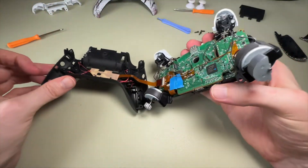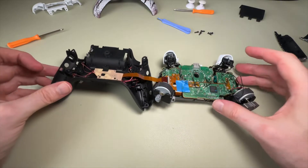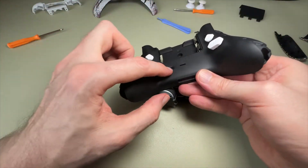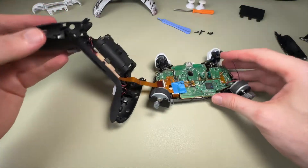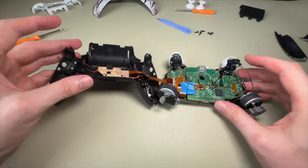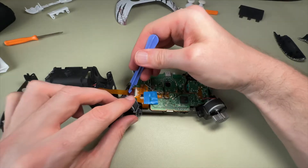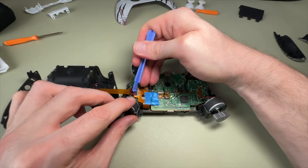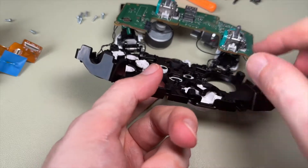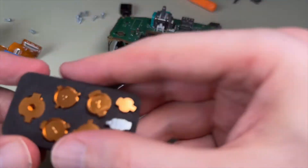As we flip it over, you can see the circuit board and cabling installed for the back buttons. If you don't have back buttons, you won't have all this ribbon cable, so you don't need to worry about some of these steps. I'm going to take that ribbon cable off by simply prizing up the little latch that holds it in place, disconnect it, and that sets the back free. If you have a default controller, the back will already be free.